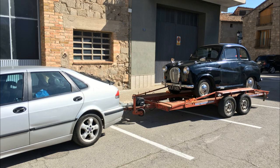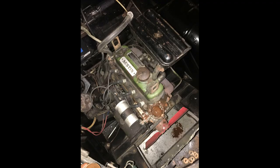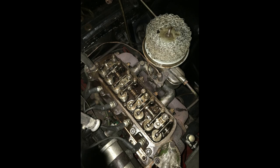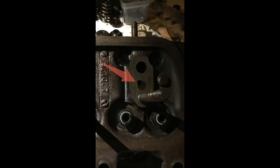My budget was tight, so that's all I could afford really. The car was overall in working order, although the brakes didn't work at all. Here you can have a look at the state of the engine when I got it. The oil and the refrigerating fluid was pretty nasty. I knew the rocker assembly needed some revising, because I was not getting any oil to that part at all. This is in fact a common fault, and that's because the feed hole is very tiny.